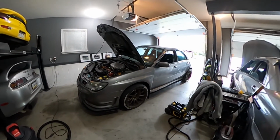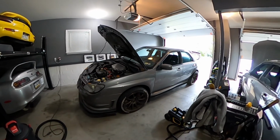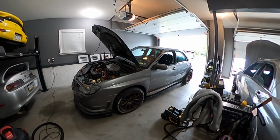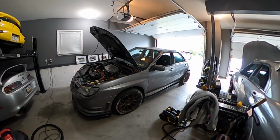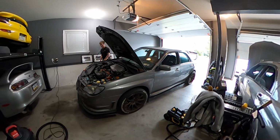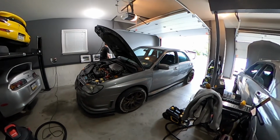But anyway, we're running into a little bit of a predicament because Jacob found cords sticking out. He must have been running camber for a while on the inner portion of his front tires. So he's looking to source out some new tires before he heads out. But we've got 2 days. Right? 2 days. That's right, because we're leaving Wednesday morning. So it's gotta be done by Tuesday.